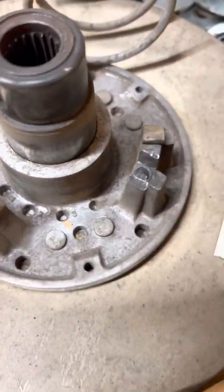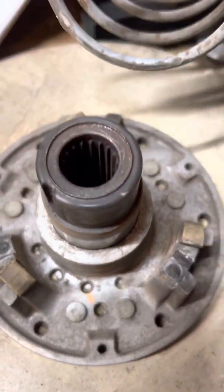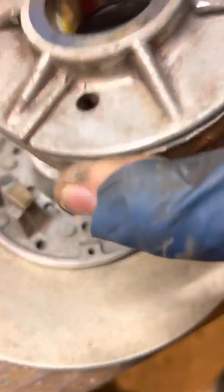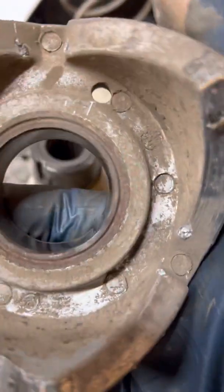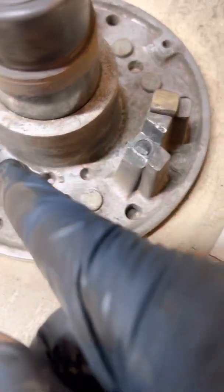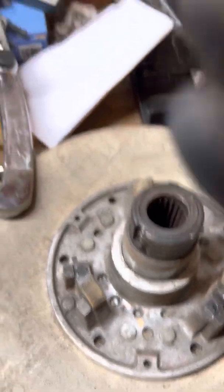I'm not even sure if this is solid, which is why I didn't really care if I overheated it. Do make note: there are different numbers for different clutches and different springs. I marked mine — this was a three. On the other end, there's only one hole on the top where you can put it, but on the bottom you could put it on position one, two, or three. So I made a notation and marked the spring as well.